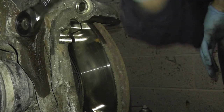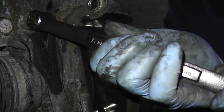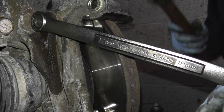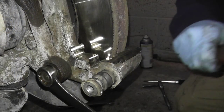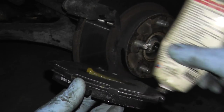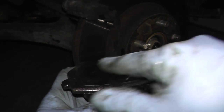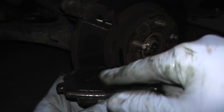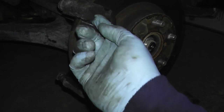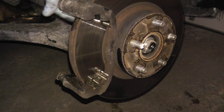If you want to torque the bolts, they're rated around 60 to 65 foot-pounds. In this case I'm just going to give it a good tightening. Now with your brand new brake pads, put a little bit of brake grease on the back. A lot of times when you buy brake pads the parts supply will ask if you want a tube of brake grease — and you do want this stuff. Also put a little bit on the brake contact points so the brake pads move nice and smoothly back and forth.